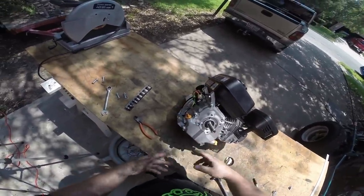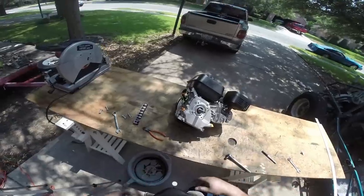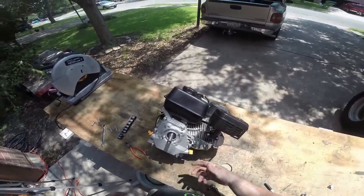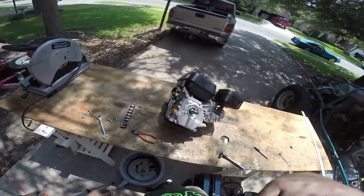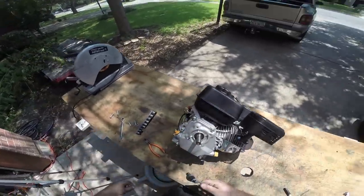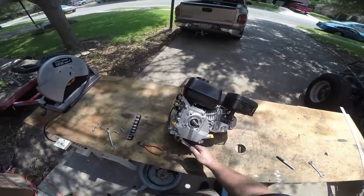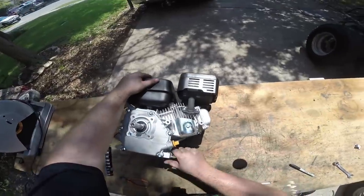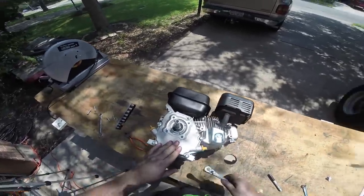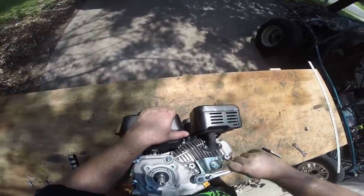What we are going to be doing is removing this cover here to drain all the oil out. We have these oil drains but we want to make sure we get all the metal particles out, so we're going to clean it on the inside, spray it out, and then remove the governor. The governor actually sits back here — once it's removed the engine will rev up to about 5,500 RPM before you get valve float. There is a torque spec on these bolts; I don't know it off-hand so I just marked them with a sharpie so I can put them back the way they were. These are 10 millimeters. Tilt the engine all the way down — it's nice that nothing is leaking, no gas leak. That's a pretty good design.